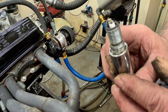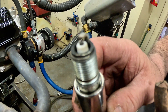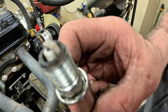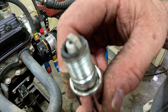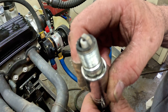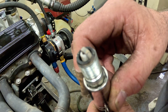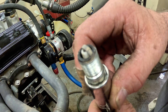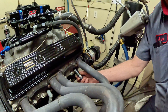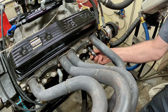Arnie is going to show us about the strap. With alcohol you're not going to show any real color like you do with gas, but you can see the strap color change — it's up in the top of the radius instead of down the bottom, a lot bigger. Technically you could afford a little more timing by that, but it honestly wouldn't be worthwhile. We've already proven more timing didn't work on the previous runs; more timing with better spark from the V-Powers wouldn't see any gain either.